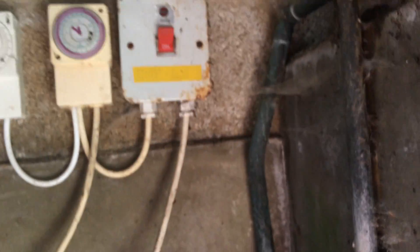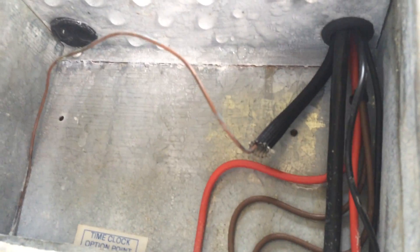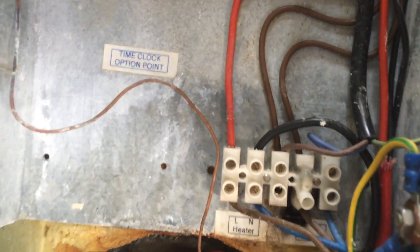I think we'd better turn this off. I don't know if that's leaking down the top and then got in there. Let's have a look in here — there we go. I think that might definitely be the problem. It's labelled up 'pump lower neutral' and it's all burnt black and melted.